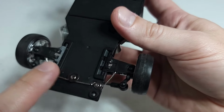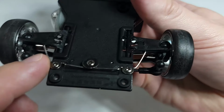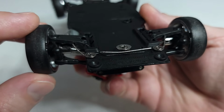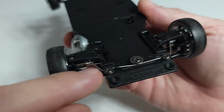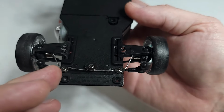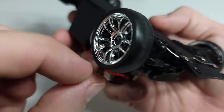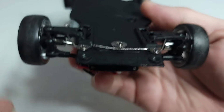And this rear end one was really tricky, especially after I swapped these swing arms around to where this side pretty much was perfect, but I couldn't really get this side to match it well, even though the spring looked exactly the same. When I looked at it from all sides, it looked like I had it perfectly symmetrical, but for some reason it was tough to get this one to match that one exactly with the ride height above the body and also the amount of sag that it would give me.